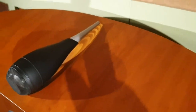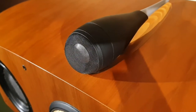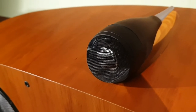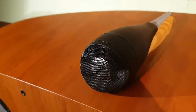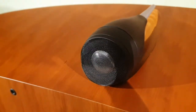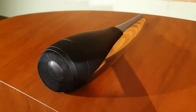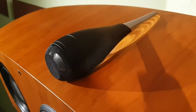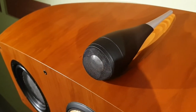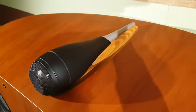It's a curved design. The tweeter is quite an interesting design as well. The diaphragm, which is made of aluminium on this model, sits in front of the magnet assembly. The magnet is ring-shaped, so energy from the back of the tweeter diaphragm goes through the hole in the centre of the ring magnet and is then deadened or silenced down a tapering tube that runs through it. Therefore, you only hear the energy that comes from the front of the diaphragm, which improves clarity by removing the out-of-phase energy from the back.